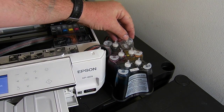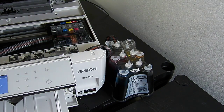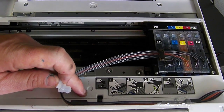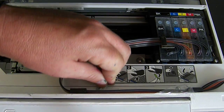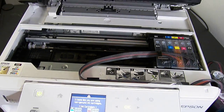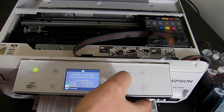Here on the end of the system you have a spare plug. Take this plug out — we're going to use it to bypass the printer lid sensor. The printer lid sensor is in this hole here, so we're going to pop that in. Now it's come up on the screen saying it looks like you're using non-genuine cartridges. Yeah, we know that — just press OK.